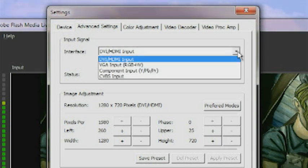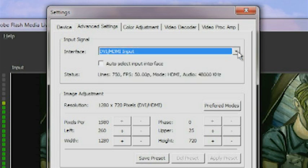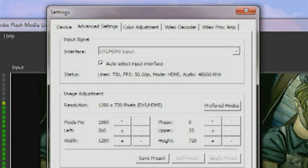At the top is input selection, which is only really needed for the multi-purpose HD inputs. And even there, the auto select seems to do a pretty good job most of the time. The only time I've had to make a manual selection is when I was using a composite input and connecting it to the green connector of the component, which is the luma channel of a component signal — because the input was defaulting to component, I was just seeing a black and white image.